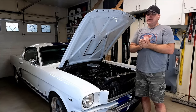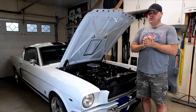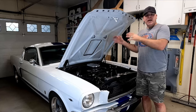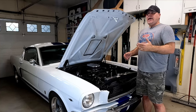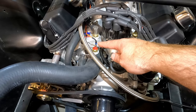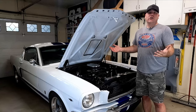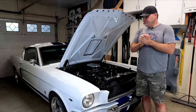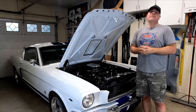The temp sensor has been working fine with no problems, but now I have a bit more control over my system. This is something you can do regardless of what car you have — if you've got electric fans on a relay triggered by a thermostat switch, you can just interrupt that signal. This override switch should work for everybody. If you liked the video, give it a thumbs up, and subscribe — it helps the channel. See you in the next one.